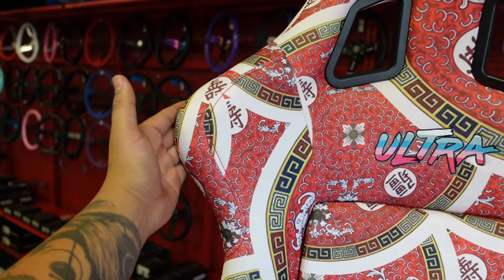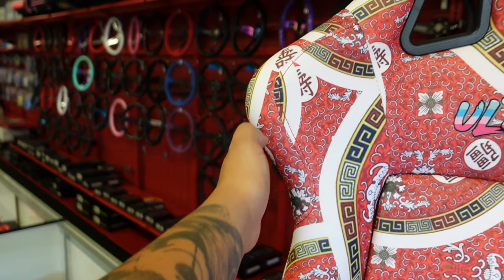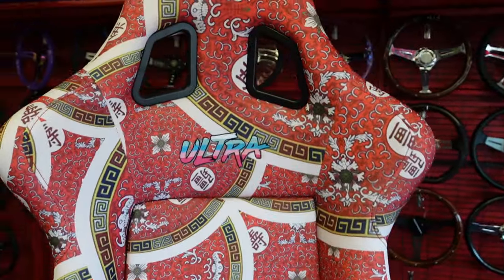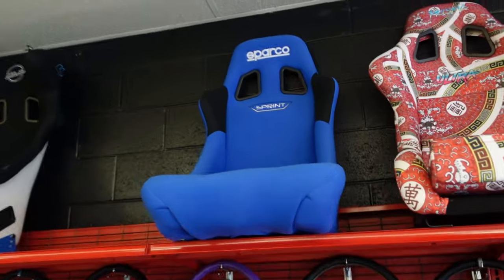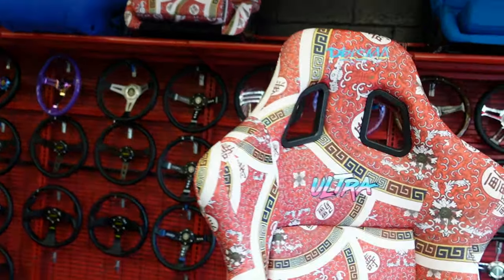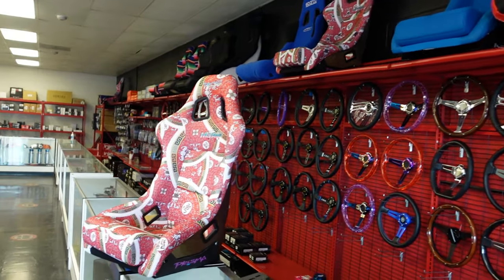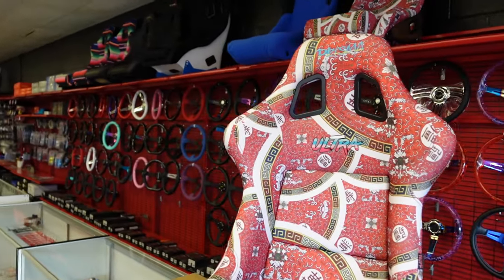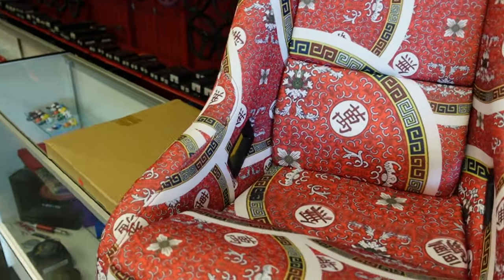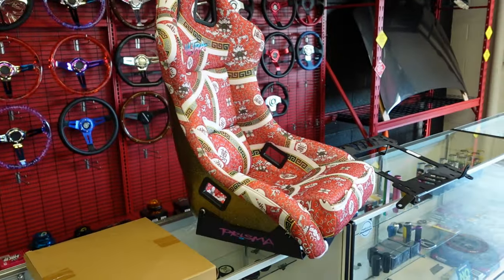These seats are really wide on the broad shoulders, so on most of those smaller cars, every time you roll up the window it's not going to move. If you have a soft top, even worse — the seat sits too tall. So this probably wouldn't be the seat for you. You would pick something like a Sparco Sprint seat, which is the racing bucket seat. That one fits in the Mazda Miata and all those small cars very easily if you want a stiff bucket seat. If you want a reclining seat, I would go with Braum, Sparco, etc. — you have an easier time dropping it into those vehicles because it has space and you need that reclining feature since a lot of times those cars have rubbing issues when you try to slide the seat back and forth.